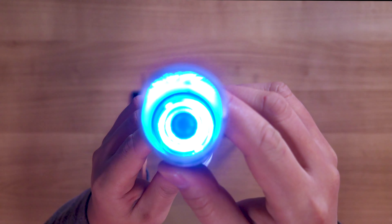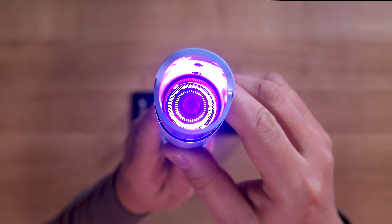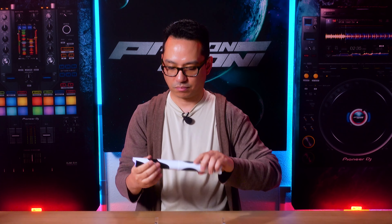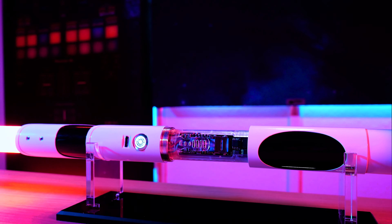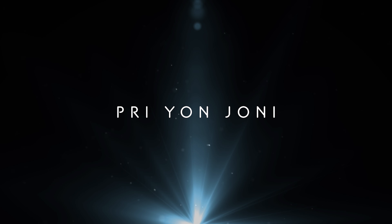I'm going to remove the blade, then remove the mounting screw — just one screw, the one closer to the battery. Then the second screw, the one away from the battery, is the one that pushes the button and the port towards the outside. Because with this screw coming out, you'll notice that the button starts easily falling inside. Now you just push the button in and you can slide the core right out.